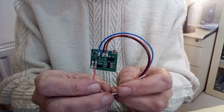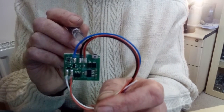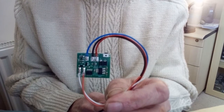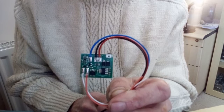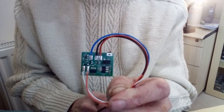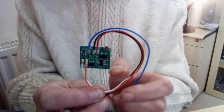As you can see, it's pre-wired and you can fit it without any soldering — we supply some solderless connectors with it. There's a very small calibration button on the top, used to carry out the calibration. It's a completely self-contained process — no need to use a computer or phone. The Unitaco board is also suitable for a wide range of ignition systems: it works with contact breakers and most electronic ignition systems, with positive or negative earth, and you can set it up for four, six, or eight cylinder operation.